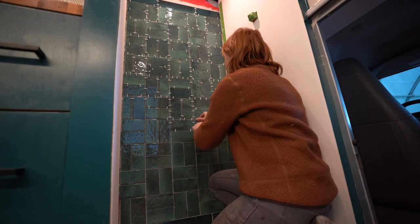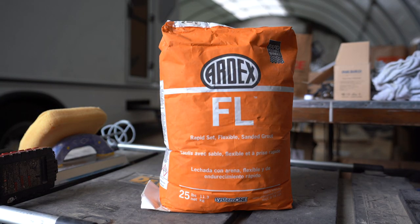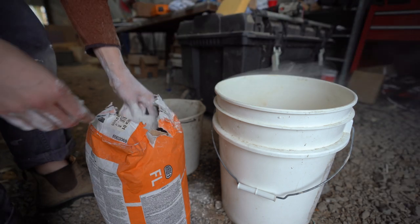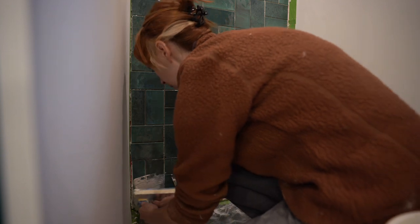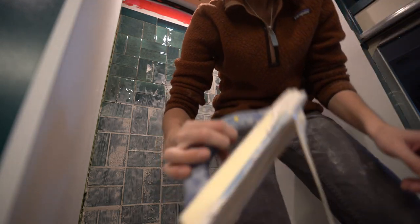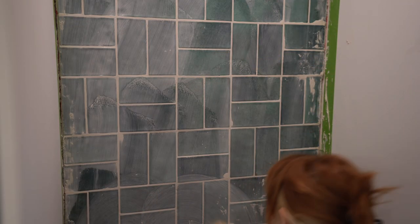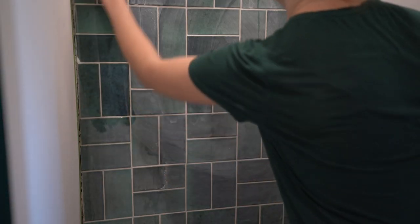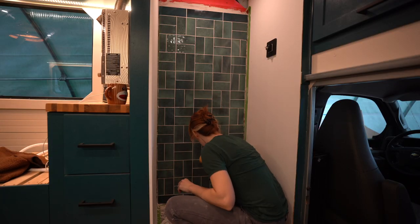Once the whole wall was finished, we removed all of the tile spacers and gave the mortar lots of time to dry. We used the exact same grout that we did in last year's bus — this is Ardex FL. We really love this grout. It's rapid set, so it goes on really easily and it hardens quickly. It's also incredibly flexible. This is a bit more expensive of a grout choice, but we really think it's worth it when you're tiling in a vehicle that has so much flex and vibration. We don't grout the seam where the FRP meets the tile because if there's any flexing or movement, that's where it's going to be and the grout will crack. The process of applying the grout is very messy looking while you're doing it, but once it's done you just take the sponge and wipe down all of the tile, and as soon as it's cleaned up that grout makes the tile just pop and it looks incredible.